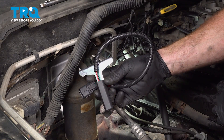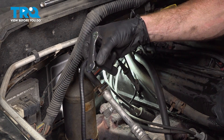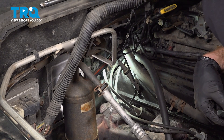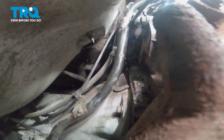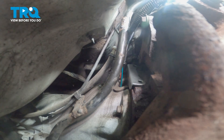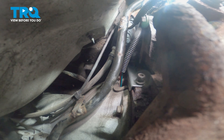Let's get ready for the installation of our brand new crankshaft position sensor. When you put this in position, you want to make sure you have the bracket so the two holes are facing towards the front of the engine. This will come down at an angle — keep that in mind. Carefully put this along the backside of the engine and slide it into place. Once you feel you have it there, start in both of those mounting bolts and then snug them up. Be careful with that wiring harness. Try to find that mounting hole, double check to make sure it's completely flush, then start in each of those two mounting bolts. Now that I have both bolts started, we can go ahead and snug them up.